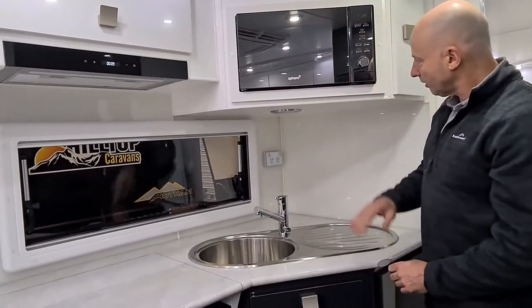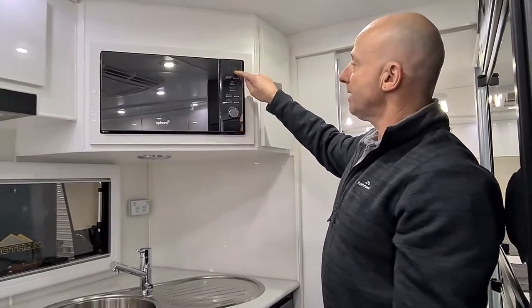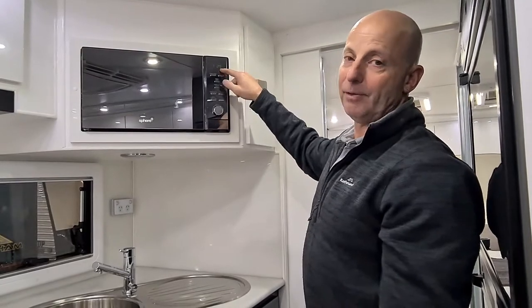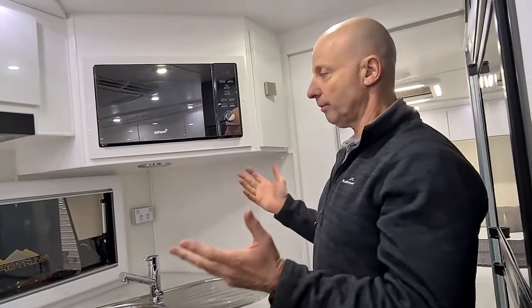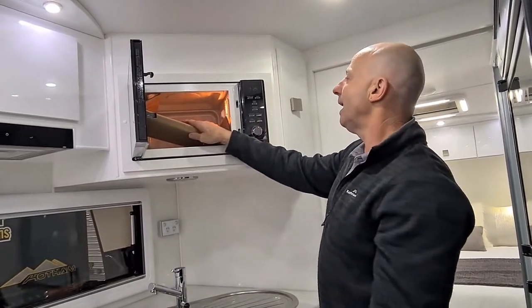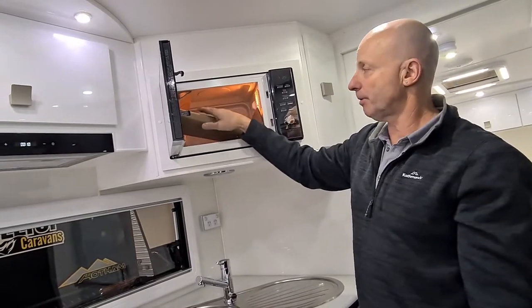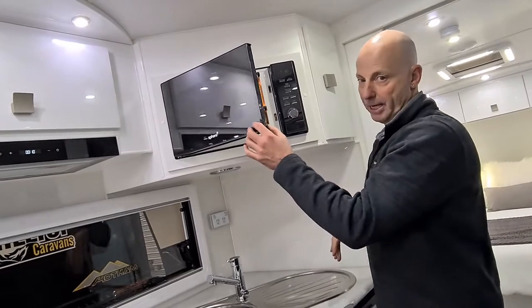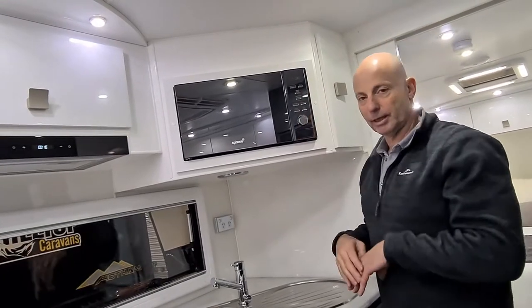Keeping on moving around, we've got the microwave up here. One excellent thing to note: we're plugged into 240-volt power at the moment and as you can see, the microwave clock is on — that's actually a really good indicator to know whether you've got power coming into the van or not. If you find for some reason you're not sure if the power is actually working — whether it's a problem with the wire, the pole it's plugged into, or the caravan — a really simple way to know is to look at the microwave. If the clock is on, power is coming into the caravan. Make sure you take all the packaging out before you use it. It is a good idea to keep the packaging and have it in there for travelling to keep the plate secure, but don't ever turn it on with the packaging in.